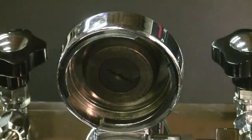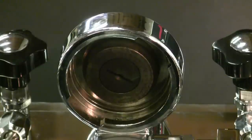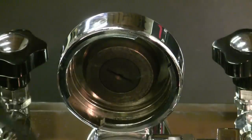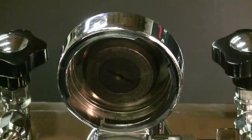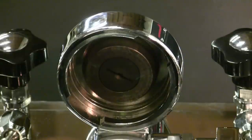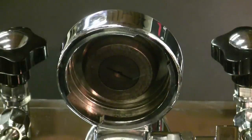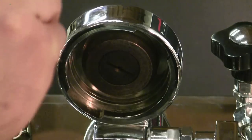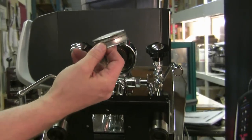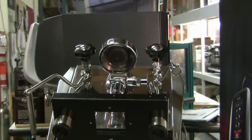You can flush this out with water — I like to use a vacuum cleaner, it works really well. Then after that, take some espresso machine detergent, or you can use a little industrial degreaser watered down — it takes off oils well — or just use standard espresso machine detergent. To clean the group head as well, you take this out. You see it gets pretty dirty on the inside pretty quickly, so soak that in some hot water and detergent too. Put that off to the side.